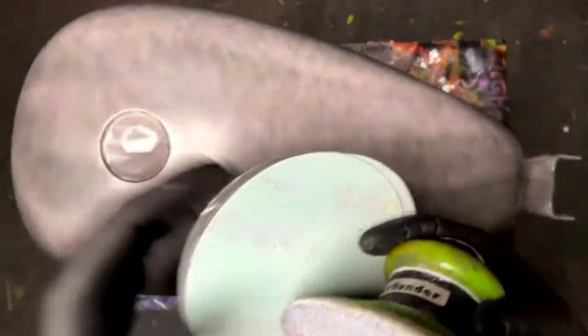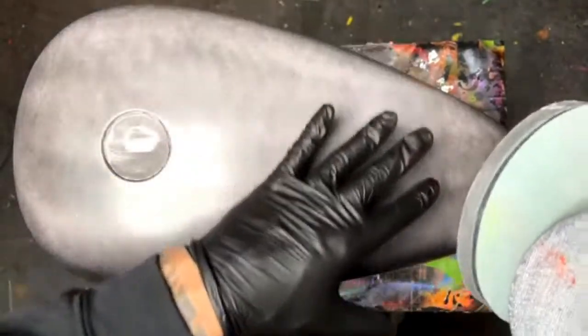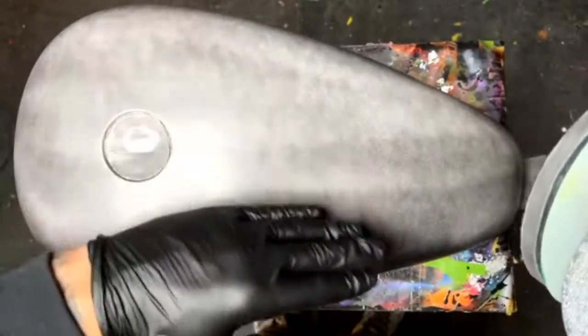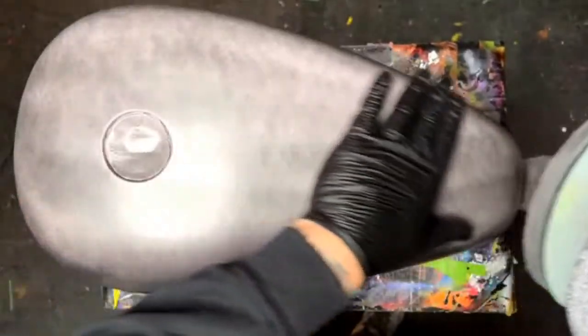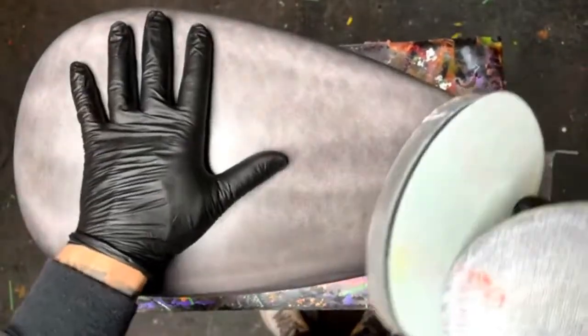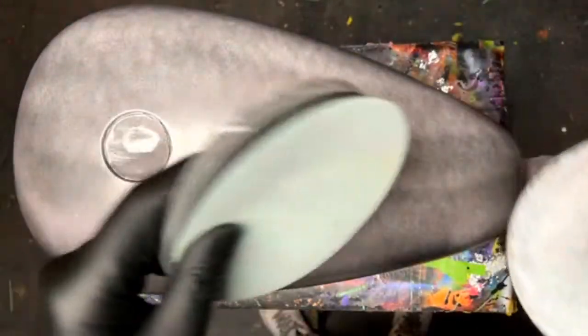We would use a hard block sander and we would crisscross and block over the damage or the imperfection to make sure that we're getting the surface all the way smooth, and we're helping, say, if there's a little bit of wave in it. This primer has some depth to it to where you can cut that wave out. So you can further do body work by using a hard block. But it's pretty good. We're going to use an interface pad with a 6-inch sander.